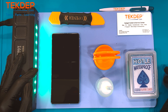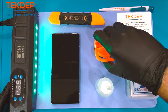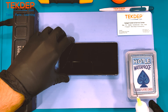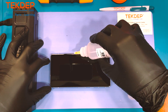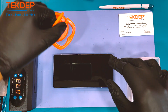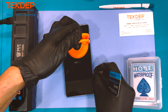We've got that heating mat set between 75 and 85 degrees — specifically set to 77 degrees Celsius this time. We are going to use that suction cup tool to provide just a little bit of pressure upwards in order to create the leverage necessary to slide the playing cards and that eye opener tool where it needs to go, in order to work through that adhesive and do so without damaging the phone. This phone does have quite a bit of adhesive. It's only rated to IP67, not IP68, but you would never know based on how challenging it is to get that screen off and how much dexterity is really required.